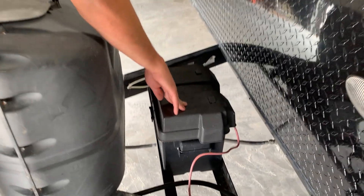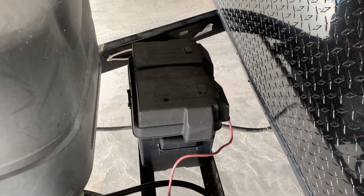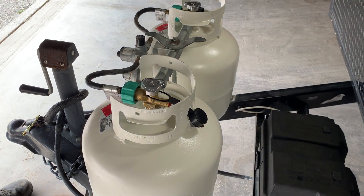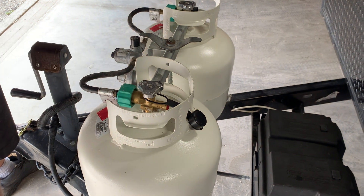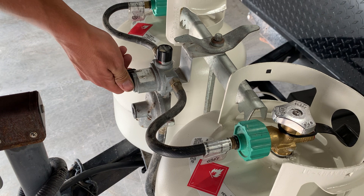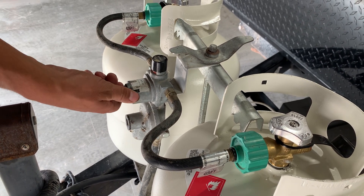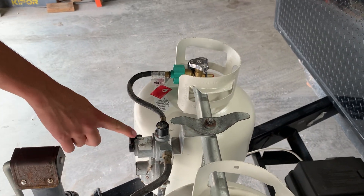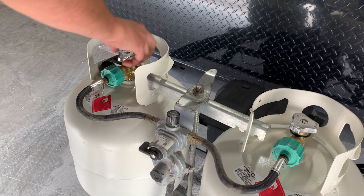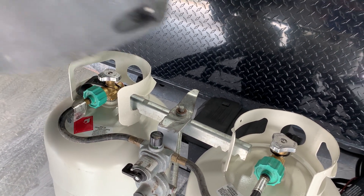In this black box here is where your battery is located. At the end of the season you're just going to want to disconnect that. Underneath here you have your two barbecue-style propane tanks — this is going to be the only way to get propane to the unit. Take note of this little black selector. You're going to want to turn that to whichever tank you want to draw off of. Making sure it's pointed toward the correct tank, open that valve all the way and now you have propane running through the unit.